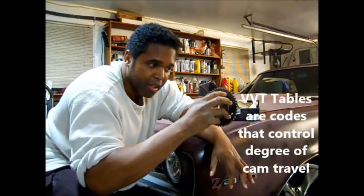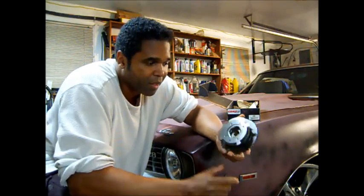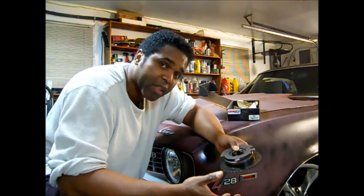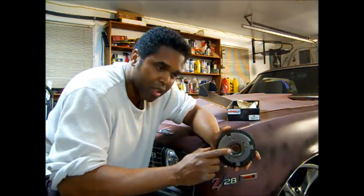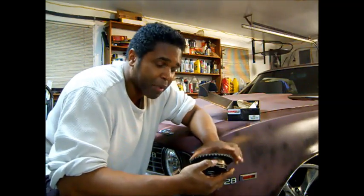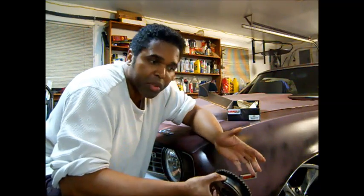What happens is, this thing advances and retards itself. It's a cool little thing, but the reason I took it out was these things start making power around 2,000–2,500 RPM. You can get a smaller cam to compensate, but the thing is GM put these in automatics. Now with the introduction of the LT engines, manual transmissions are having these too. I took mine out because it wasn't making much power off idle and was pretty much a dog up until about 3,000 RPM.